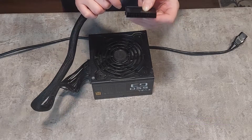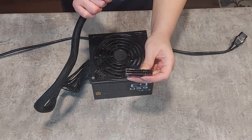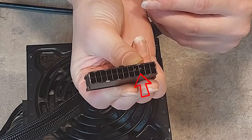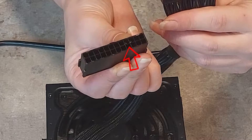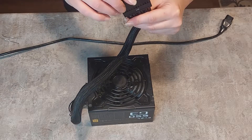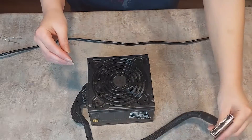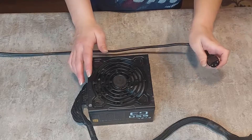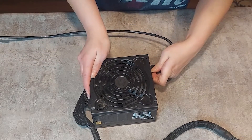This is the EVGA detection tool — it came with my PSU. It's also referred to as just a PSU tester. There are just two pins in there; those are the 16 and the 17 slots. Pin 16 is the power on, and pin 17 is a ground. This test basically tricks the PSU into thinking that it's actually connected to something.